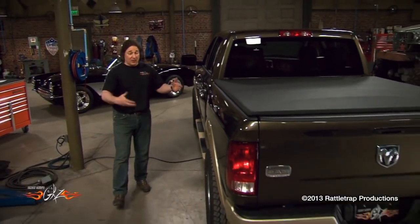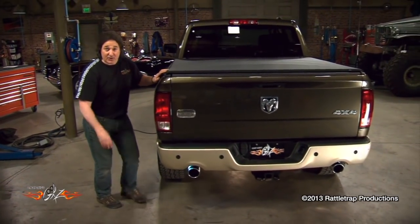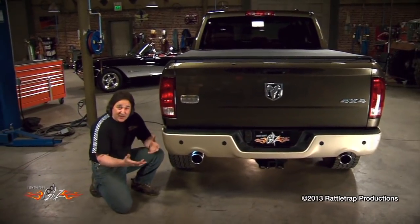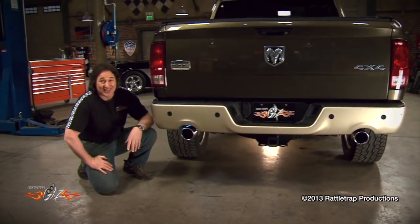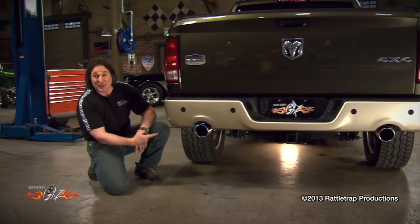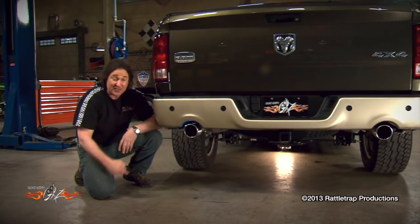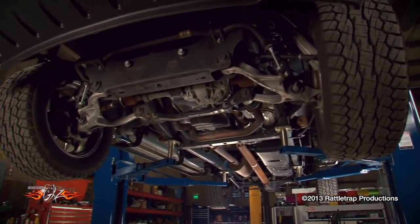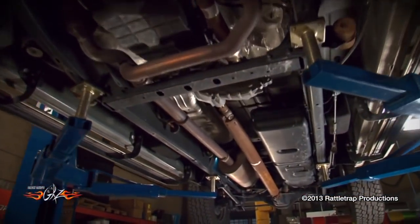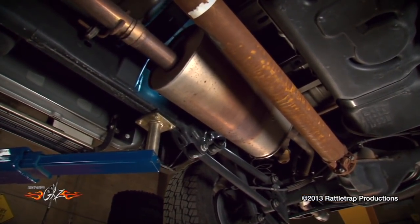This truck is typical of the newer vehicles you'll see out on the road today. It's got dual exhaust blowing out the back, so you would think it would flow like crazy and sound great. But that's not necessarily the case, because that muffler is so restrictive it's choking everything down. Really, all these dual tips are doing is just looking good. When you look underneath, you can see that all you need to do is replace this huge muffler that's underneath here — and that is something you can do in a simple weekend.